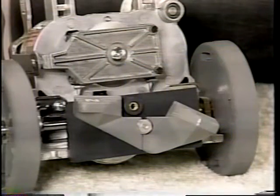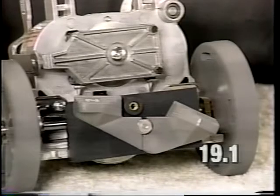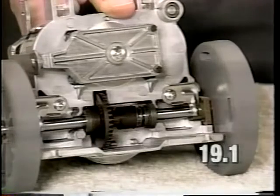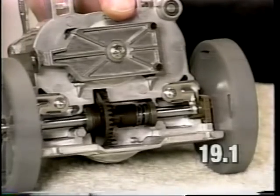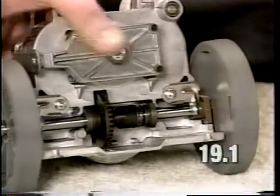If a squeaking noise comes from the transmission when rolling the unit across the floor with the pedal in neutral and the motor off, it could be due to a lack of lubrication at the tip of the bracket lever assembly and the overload clutch. Remove the neutral drive pedal as described in section 13 of the video. Apply a small amount of T160S green grease to the valley of the overload clutch gear where the tip of the bracket lever assembly rides.